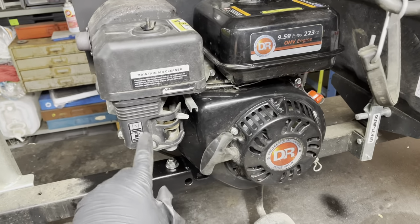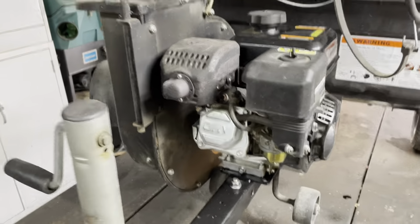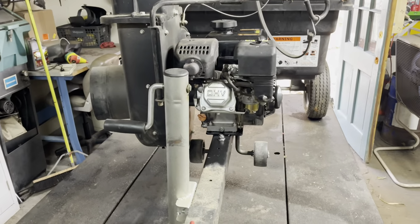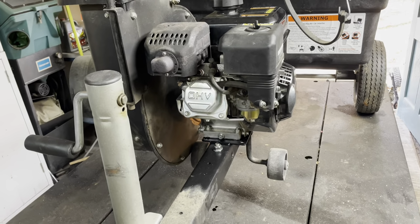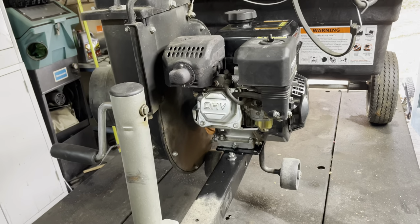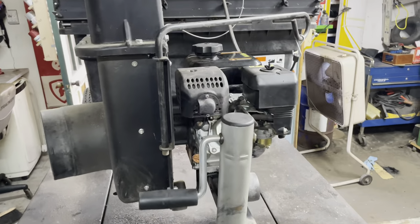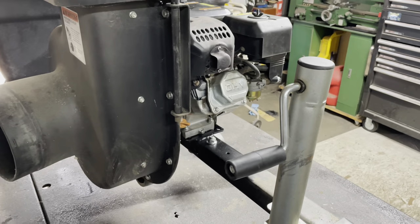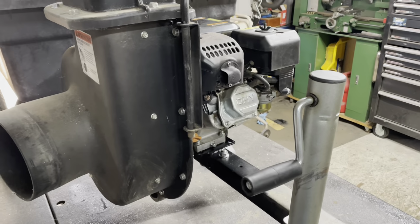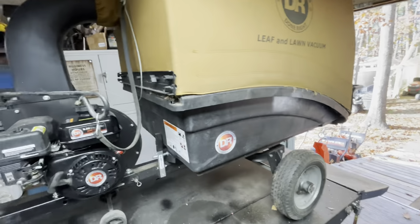So it's going to keep sucking fuel in. I've had people have rough starting issues who shut them off and try to turn them back on. Backfiring out of the exhaust, washing the cylinder out. I'd rather be on the safe side. Is it going to kill the engine? No. But why have unburnt fuel going into the cylinder and gumming up the works if you can help it?